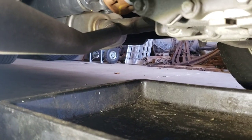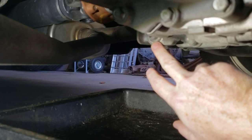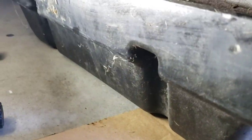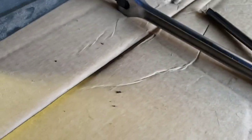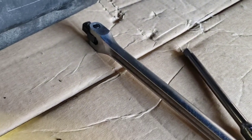Under the truck — here's the rear differential case. Right here is the drain plug, just takes a three-eighths drive. Once we loosen that, the crush washer has been compressed so it's damaged — we'll need a new one. The vent and fill plug is up above, past the gas tank. There's a little pass-through hole, and if you line it up you can see the plug right there. It's three-eighths also and it's pretty tight, so I've got a six-inch extension with a half-inch breaker bar adapter to fit.